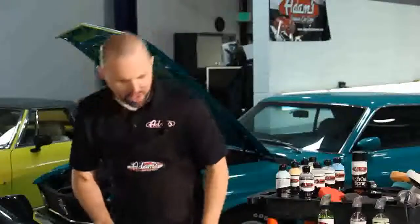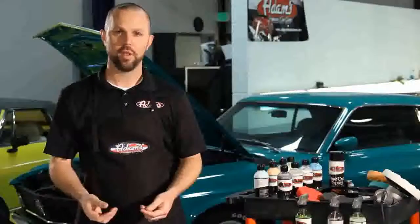So far I'm seeing a very big improvement, but it's certainly not perfect. There are some deeper scratches here and there, so I may want to do an additional pass with the Porter Cable. Some of these deeper scratches may need more intensive correction — our four inch focus pads or the flex polisher. This may be good enough for you; if this is the standard you think is perfect, do the rest of the car and enjoy it. Also, something to remember: your polishing pads are going to have polish in them from that first pass. You don't need to add the same amount every single time — two to three, maybe four drops of polish for each new section like a door or fender is enough. If you add a huge line of polish every single time, you're going to cake the pads up and they'll be less effective.